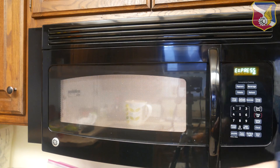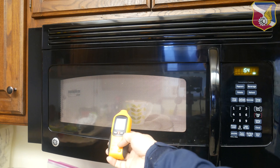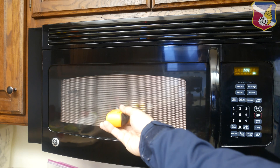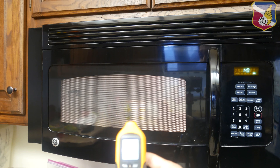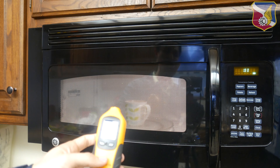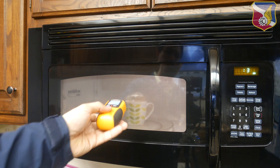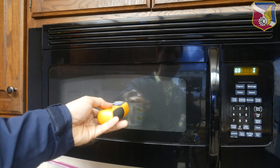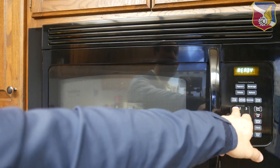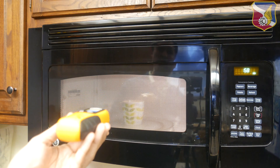Let's set it for one minute. I'm positioning the detector in front of the microwave so you can see — the warning signs are going up. It's reading over ten milliwatts. If it's over five milliwatts per centimeter squared that's way too much, and when it beeps that means it's way over. Let's turn on the max setting — at a close distance of about three inches it's reading 5.79. Moving it further away, about a foot away...